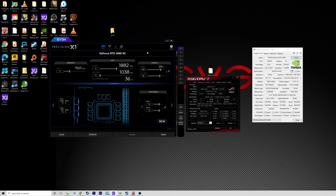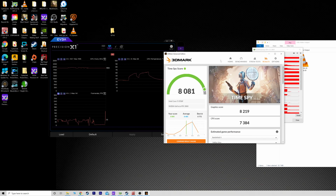It shouldn't affect 3DMark benchmarks, but it does affect certain games like Cyberpunk. Not that I'm going to probably play Cyberpunk on the 3060, but if you wanted to play the game in 1080p and get a little extra performance, get that resizable bar if you can. If your system isn't too old, I would just go to your motherboard manufacturer's site and check. It doesn't hurt to look. It doesn't take long to flash the BIOS. It takes about 10 minutes total, just mostly waiting for it to do it. So with that said, we'll go ahead and run some benchmarks and see how they pan out.